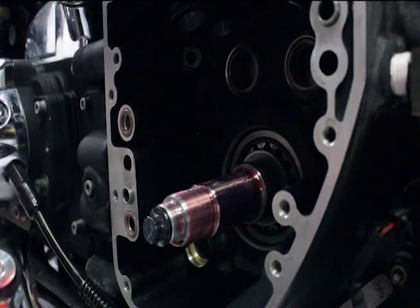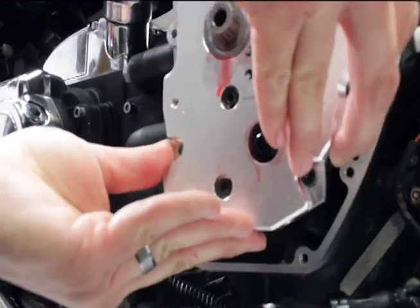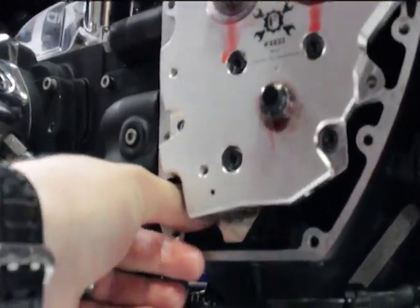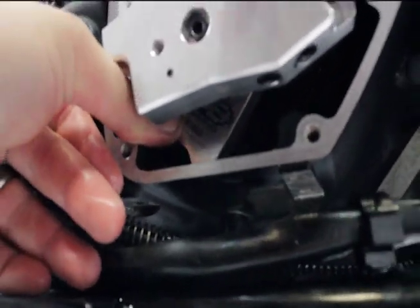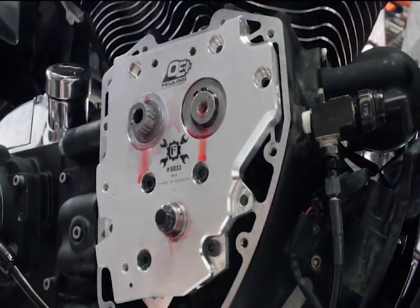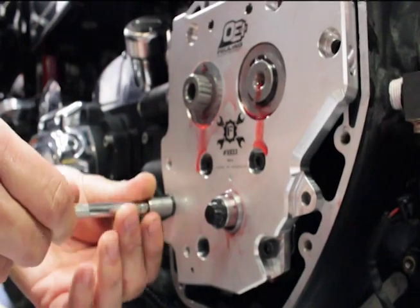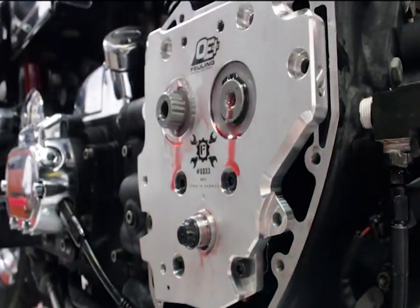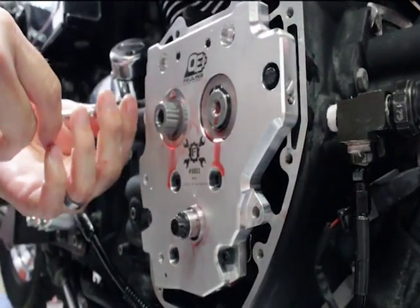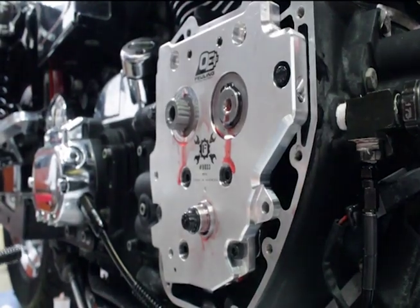You can see the flats on the crankshaft have been set so that the flats are on the top and the bottom to correspond with the oil pump flats that we aligned earlier. If you need to, rock it back and forth just to get the flats to go in. As we get into the seating point, put your thumb down at the bottom of the oil pump and press in to get that O-ring engagement. You should have a real positive engagement as the cam plate seats up against the mounting surface. Our cam support plate bolts are already pre-lubed with ARP moly lube supplied in the kit. Install these finger tight, then roll over the engine to help center up the cam support plate and oil pump, and step torque these as we tighten everything down.